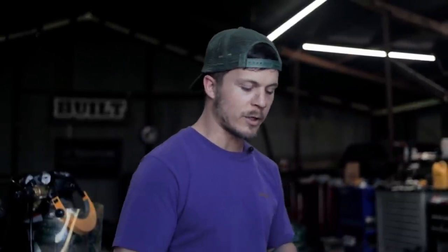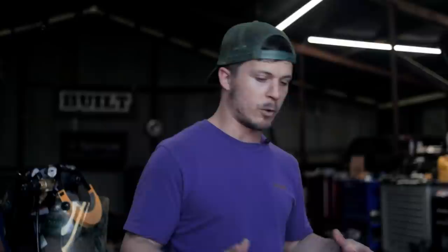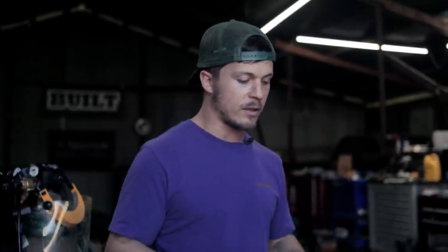So I went home, got some sleep, feeling much better. Yesterday I was working off of very little sleep. Today I'm working off of a full night, which is awesome. So I was able to think a little more clearly. And our biggest issue yesterday, well, one of the three, was our chain. So our chain kept coming off. As soon as you'd hit speed, it'd come off. Well, there was a few things that were contributing to that, but mostly the sprocket from the engine and the sprocket on the axle weren't lined up perfectly.